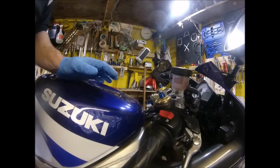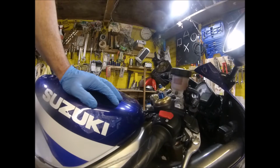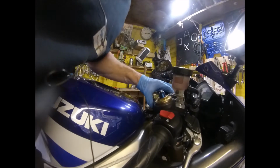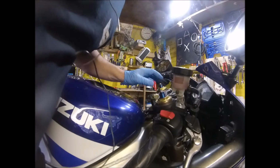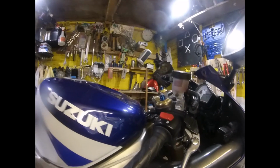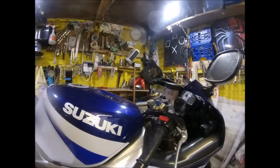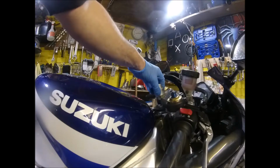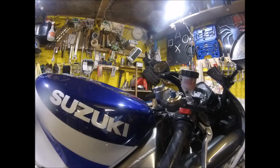So first thing is to, I don't know really, drop the clip-ons off or bleed the brakes or just take the top yoke off. Just don't know. If I remove the yoke, I might end up with the ignition in the way. Anyway, let's remove the yoke. Right, so I want a big spanner for the top. 32mm, and the breaker bar, I think.